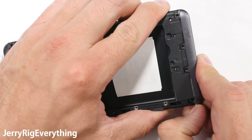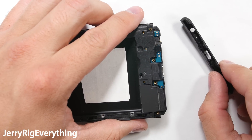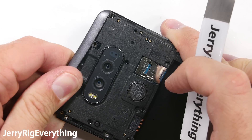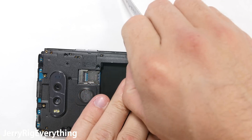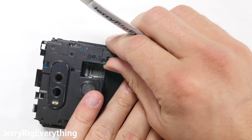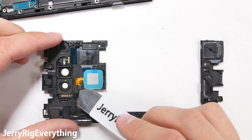After the screws are removed, the top and bottom sections of the phone will pop off. These are made of pure plastic and are held very firmly in place by a few clasps, so you do have to get semi-aggressive with them. After those are removed, the rear back plastic can come off. This exposes the loudspeaker, the fingerprint scanner, the rear sensors, and the flash.